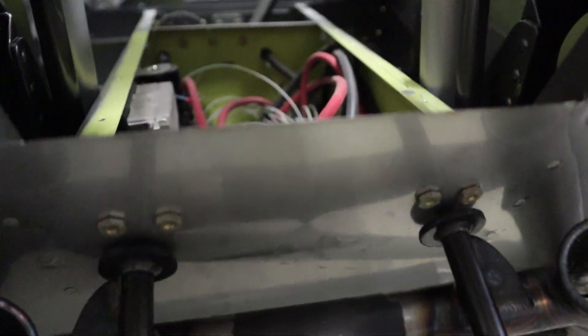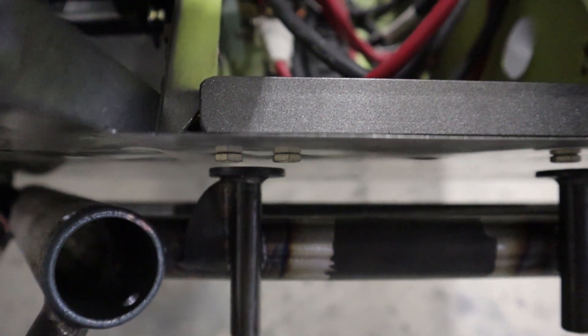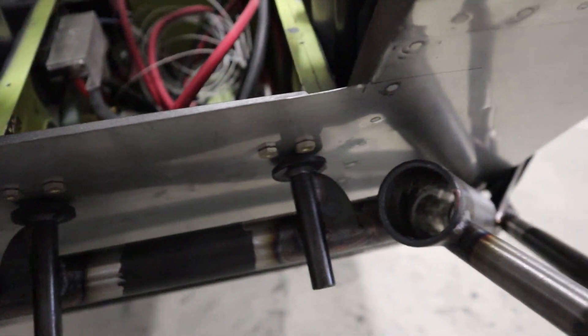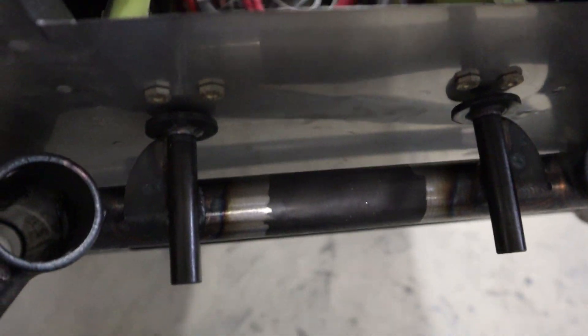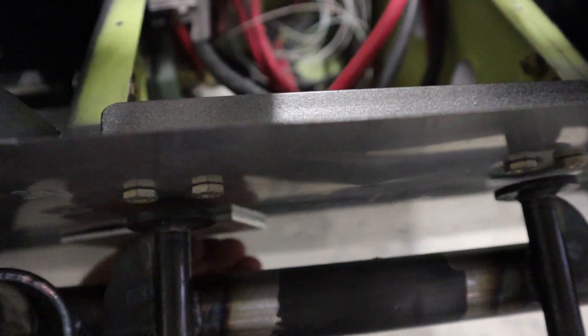In the middle, those two center holes are not drilled and there is a bit of a gap — about three-sixteenths of an inch. The instructions say you can shim all these mounts as required. Since there are no holes in those center ones, we'll need to drill those.